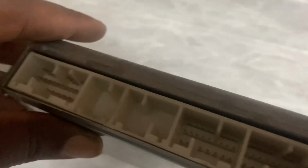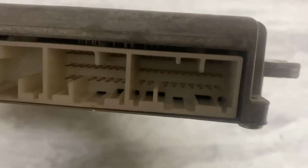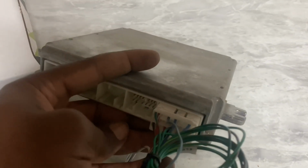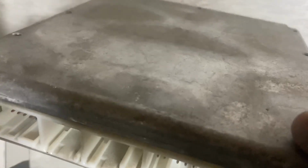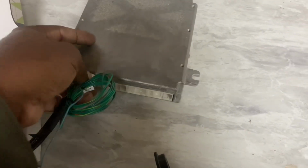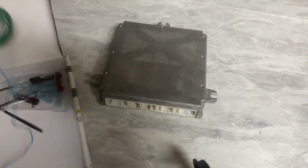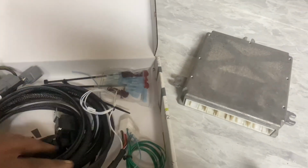Just to make sure that you guys don't get confused, because some people have, E-plug is by itself. So never put the E-plug next to the one that has another plug next to it. These are plug A and B, but I'll show you guys. E-plug does plug in to plug A. So this is a possibility. I have diagnosed cars where people have had this problem. The best way to say it is just keep the engine harness next to each other, plug A and plug B, and then you can plug this in last, or you can plug this in first, and A and B. But just want to say that just to let people know who haven't done a K-swap before. It can get confusing, especially if you're not really into wiring like I was in the beginning. I didn't really know wiring too much either, but I did learn over time.